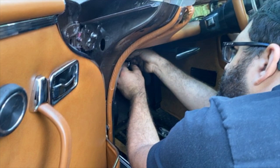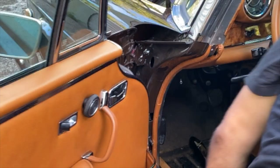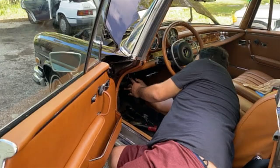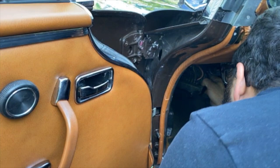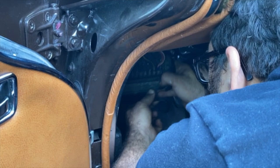That soldered really nice and firm — that's what you want. This is firmly bonded to its wire and it's not trying to come off even when I pull on it, so I know this is a good repair. Now we're going to go to the area where the problem originally occurred. This is on fuse terminal two, which is a little hard to get to.